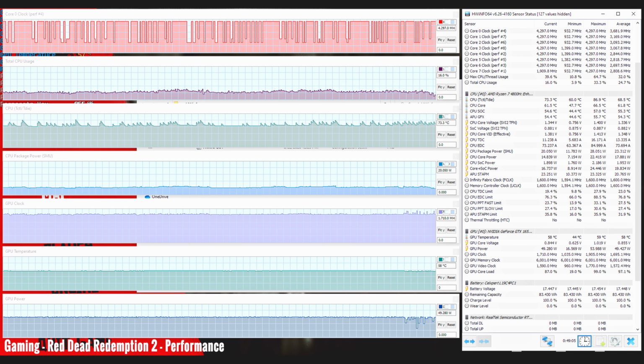At the same time, the plastic chassis only reaches temperatures in the low 30s with daily use, or mid to high 40s in the hottest parts while running games. The WASD and arrow keys rest cooler in the high 30s and low 40s, so longer gaming sessions are comfortable on this configuration. However, expect this to differ on the higher GPU options.